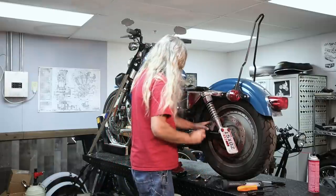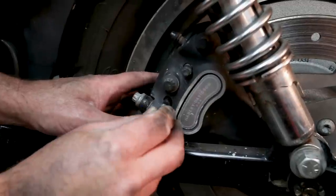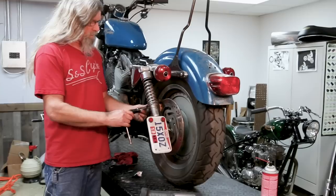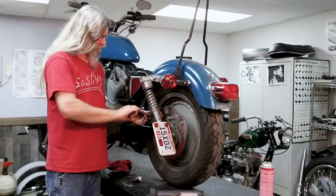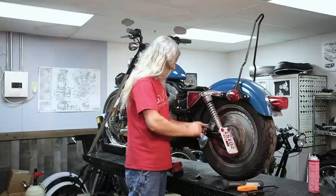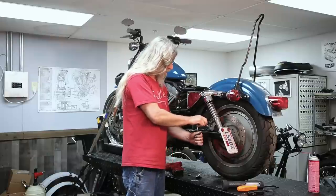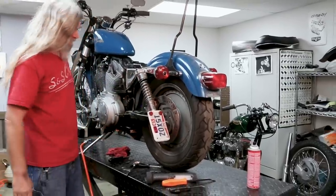Go ahead and reinsert your pins — see how that slid right in there. Once you've got your pins lubed and pads aligned, go ahead and tighten those down. Those pins allow the pads to float back and forth on them as you're hitting the brakes. Make sure you torque those to factory spec.